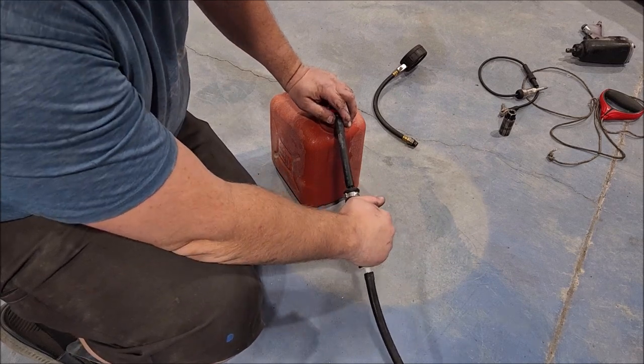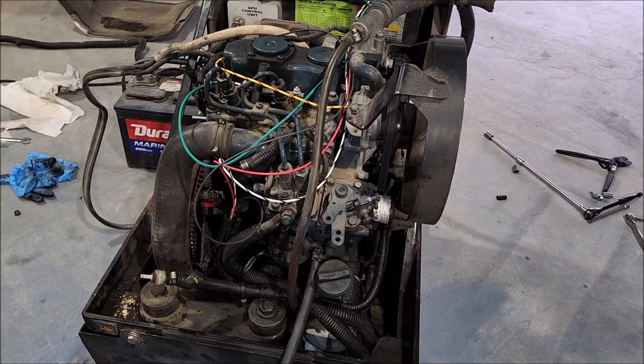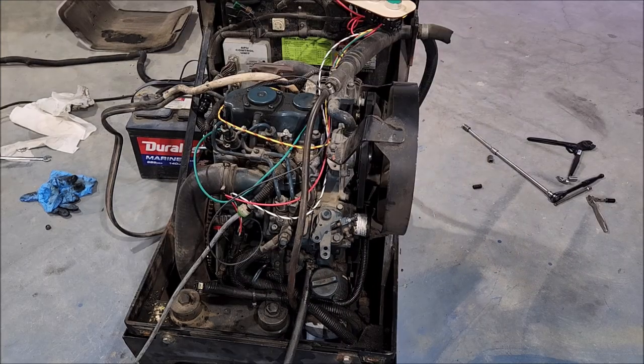And we can feel fuel everywhere off the bat. Primer. We get fuel. All right, so apparently we have a fuel return, and I've got to figure out where that's going to go. Got a small fuel line on the return. We'll start pumping. Check for leaks again. Yep, our bulb is firm, so we should be primed.